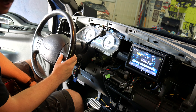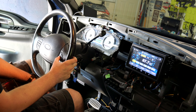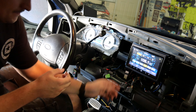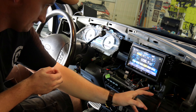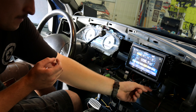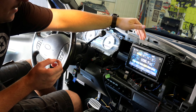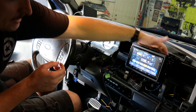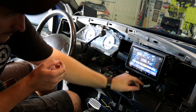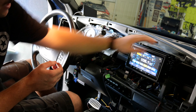Alright — steering wheel controls work! Here's what I did. I looked at the manual. The SWR-FD-60L — one of the wires that I said we didn't need actually plugs into the other side and has an aux cord that goes to the back of the radio, right next to your microphone input. So I plugged that in and then plugged it into the microphone input. It's the one with the blue wire — but the blue wire we do not need, because that is for JVC or Kenwood radio decks. I connected that into the back of the radio and voila — steering wheel controls work!